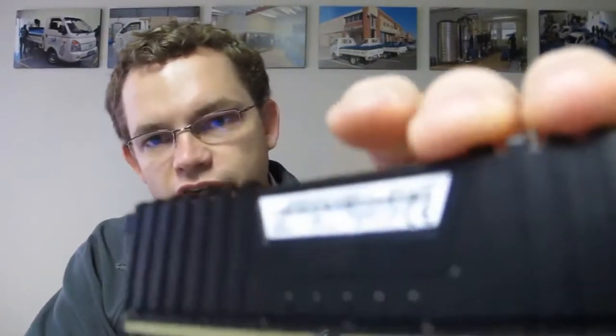For guys that like to set up their own systems, what's very convenient is on the Corsair RAM they've actually got a little sticker at the back here where it shows you your voltage to set in the BIOS, the frequency you can set it to, and actually the individual latencies you need to set to achieve the rated frequency on the package.